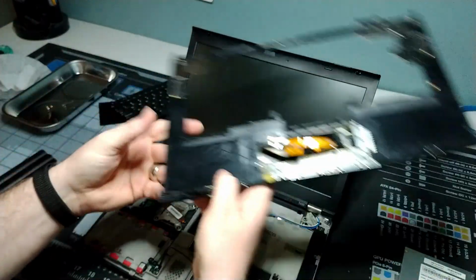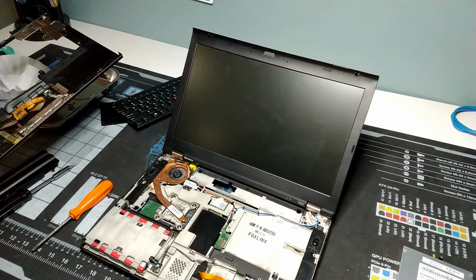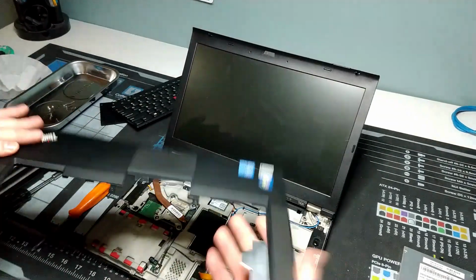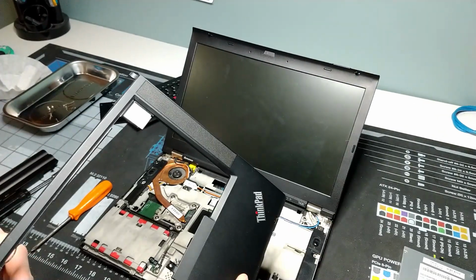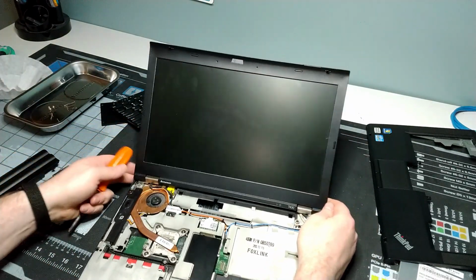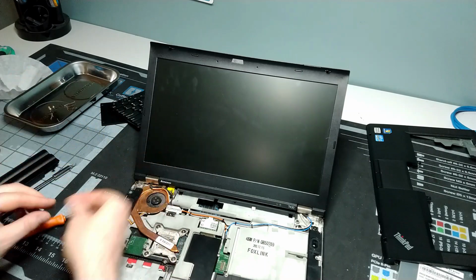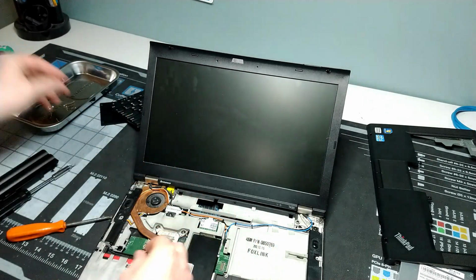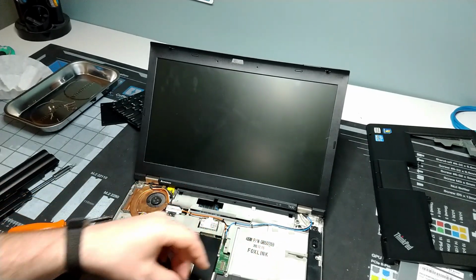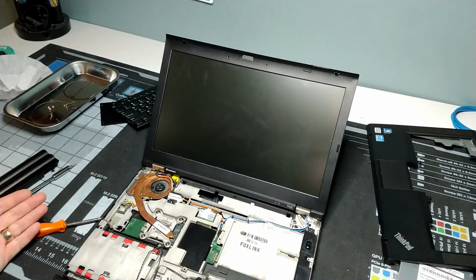And then this plug here would plug into, I don't remember what spot it goes into on the system board. It's around here somewhere where there would be a connector to plug in the fingerprint reader as well. But that's ready to move out of the way now. And the last thing we need to do to make sure we're clear to remove our cooling is this one big fat screw, and that will allow us to gently lift away our speaker on the left side of the system. And now we have access to keep going.